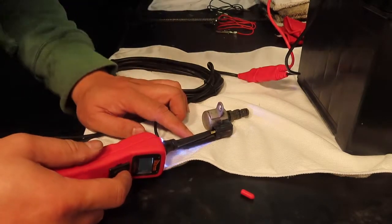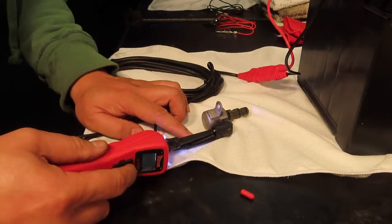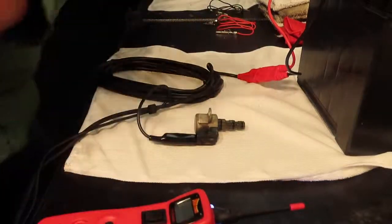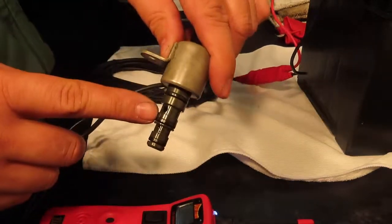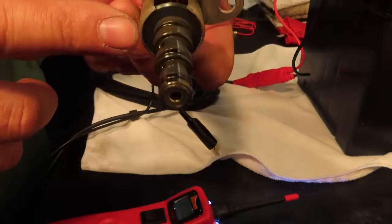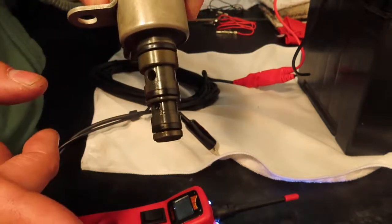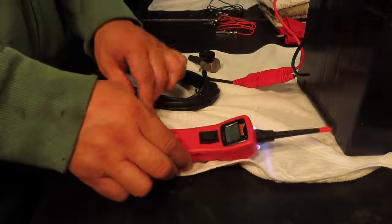But I do not see anything opening or closing. This shows that this is a bad solenoid because it's not opening and closing. In these hose ports here, you should see it opening and closing — that way it can let oil flow and not flow, so it opens and closes it off. Anyway, that's how you test the solenoid. Thank you.